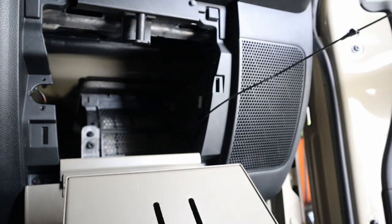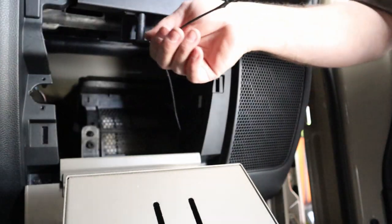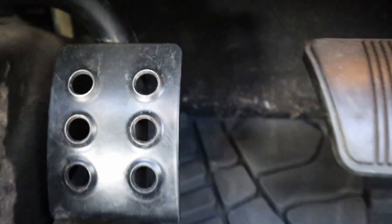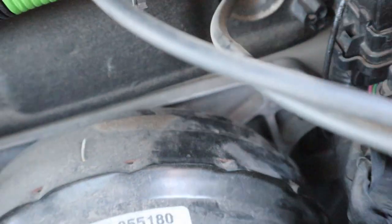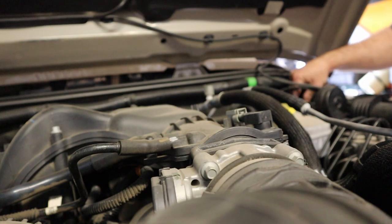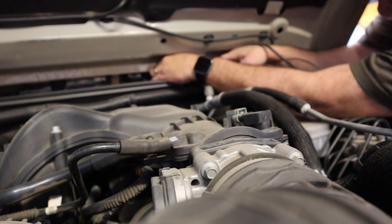What we're doing here is we're pulling up the wires from the A-post, behind the glove box, underneath the dash, to where the clutch pedal would be on a manual. You'll see a plug up here on the left. I stuck a metal tool through it to put a hole in, and ran the antenna wire up and through into the cowl, where I'm going to relocate the antenna.